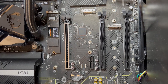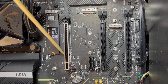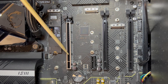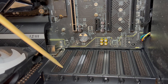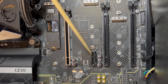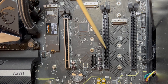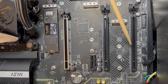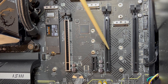The four PCIe expansion slots are the next component we will go over. Of these four slots, the top one in silver supports the newest blazing fast PCIe Gen 5.0 standard, and is connected straight to the processor. Each PCIe slot has a corresponding space on the back of the case for graphics card ports to line up with. These other three slots support PCIe 3.0 in either X1, X4, or X16 configurations. Keep in mind that the remaining PCIe slots run off lanes from the chipset, unlike the top silver one which is directly connected to the processor.